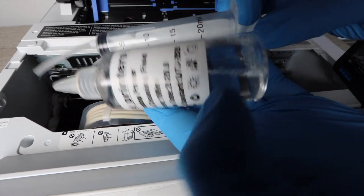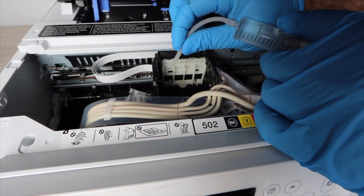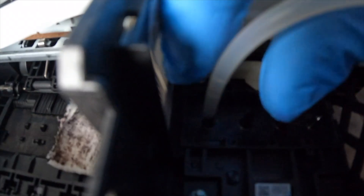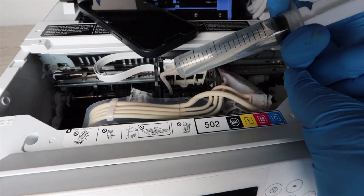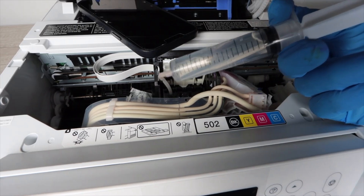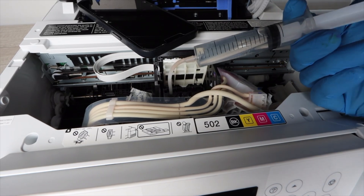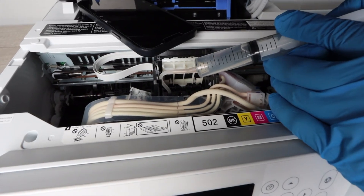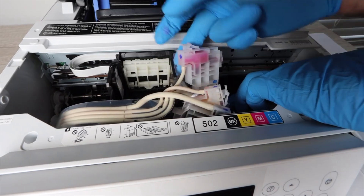Now use the Best Printers Cleaning Kit — link in the description. The kit includes silicone tubing that fits over the syringe body on one end and over the nozzle on the other. Starting with the black ink nozzle, make sure the tube is completely secure and snug. The tube is slightly smaller to build up pressure — it's a tight fit, but if you pinch it and push it into place it will fit.